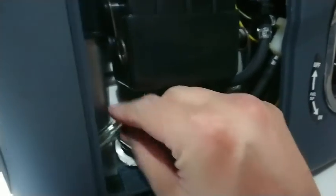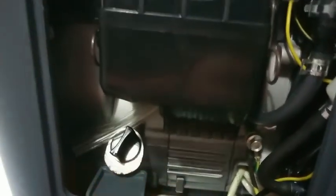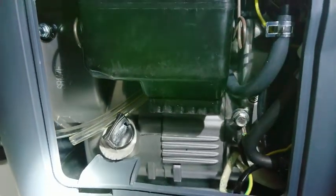So I will read the manual. It's clearly below the fill point, as was illustrated on the side here. I'm noticing that the end of this is all oily down under here, and then there's these two tubes down here. Let's shine a light in here again. There's those two vinyl pipes, and one of them looks oily. I think they're breather tubes for the oil chamber.